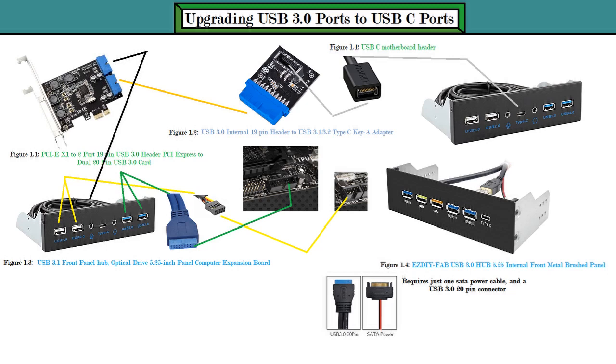You're not going to be able to connect a USB flash drive and boot a USB device from that port — it's not going to be possible. Because the only way you're going to be able to use that adapter is by booting into your operating system, since you have to install the driver for that card.